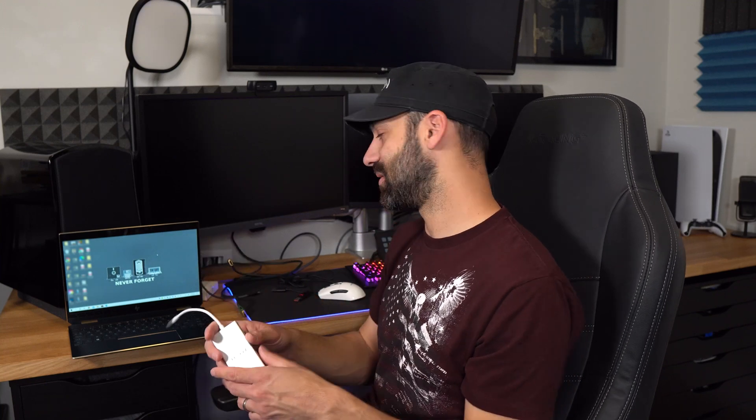The other type of people are the IT folks. If you're looking to get this for an office, this is a driverless dock. Most people see USB and say it's just a hub, but the video side can get complicated. Some laptops don't natively do USB-C to HDMI — you need some kind of adapter or driver. The way this works is there's a 4GB flash drive built into the chassis that has a 45MB file. You double-click it, launch it, and now you can leverage two additional screens on top of the laptop's built-in display. And with the built-in storage, you can put a couple of other important files on it as well.